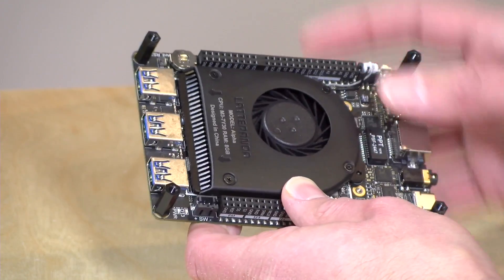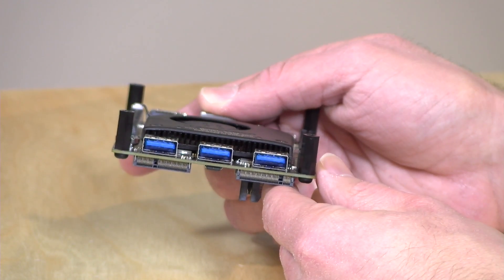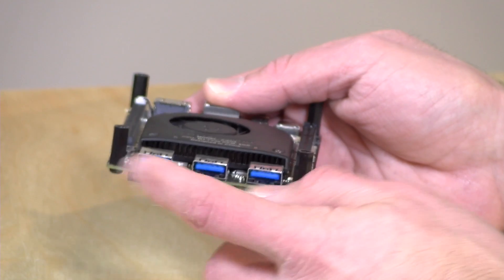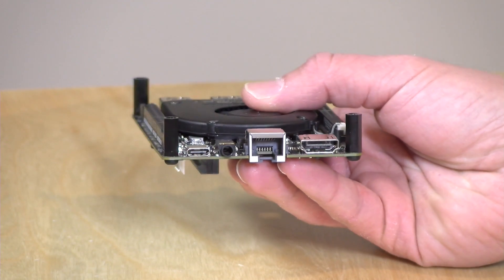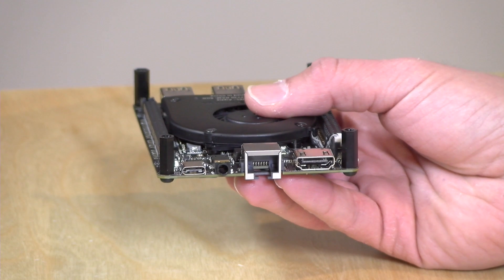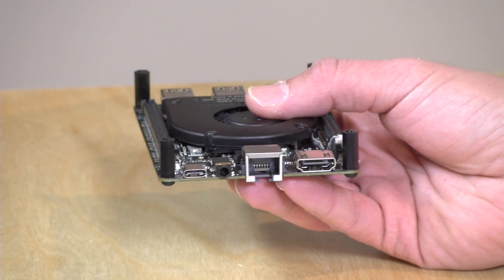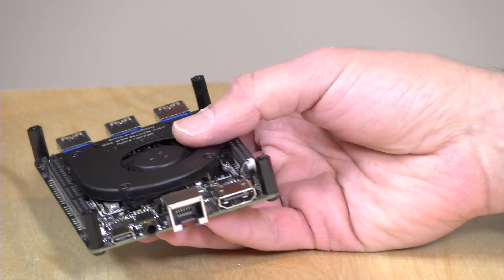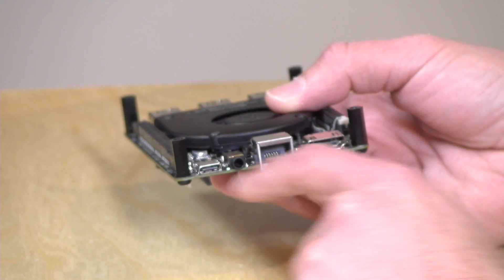It's even got a real-time clock — that's what the little battery is for on that side. Over here you've got three USB 3.0 ports, which are very useful; you can even boot operating systems off of those. On the back there's the USB Type-C connector, which is a full-service connector — it does power delivery in, shoots DisplayPort video out, and allows USB data devices to be connected. I've got a dock on the desk so I can plug in a single cable to get my monitor and a few extra ports, so having that port be fully functional is pretty helpful.